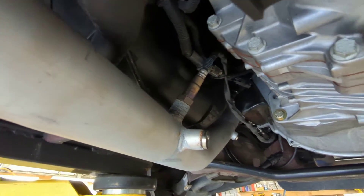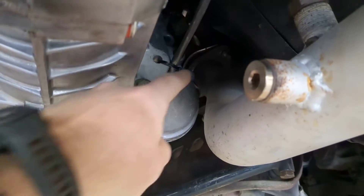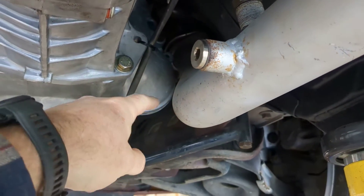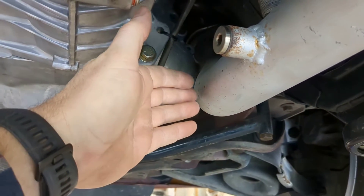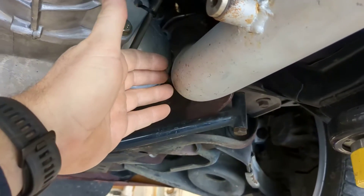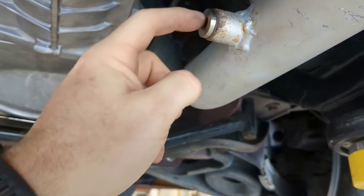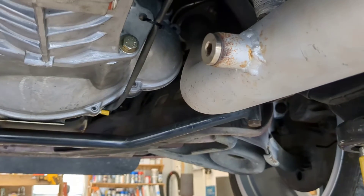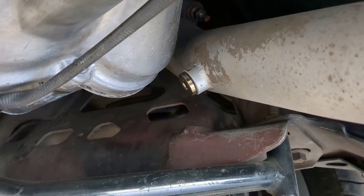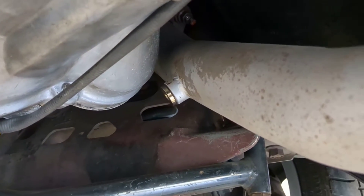In the top position I've had pretty good luck so far — knock on wood. Here's my thought process: if you look at the curvature of this pipe as it comes out of the header, it comes down and there's a bend. Logically, that bend is going to push the moisture to the outside of the pipe, since the fastest-moving air or water in a pipe travels along the outside bend. So placing the sensor on the outside bend means it will be constantly whitewashed with moisture.